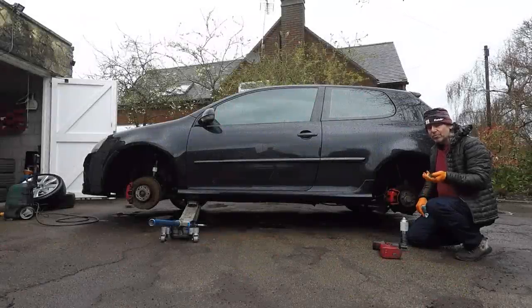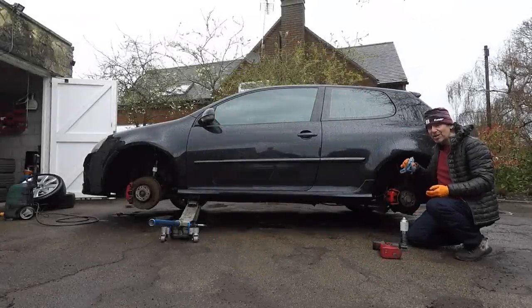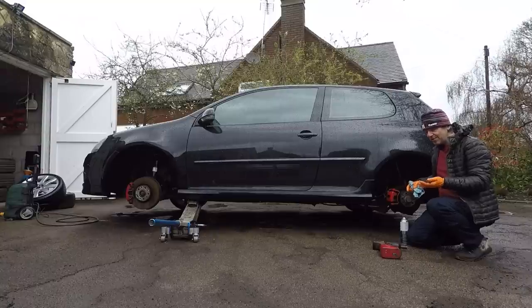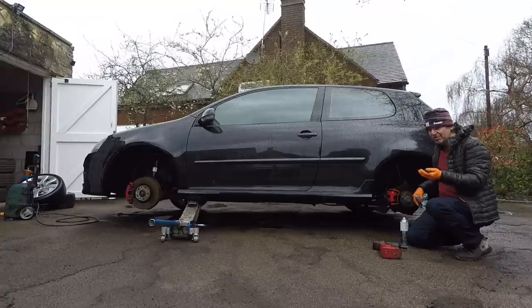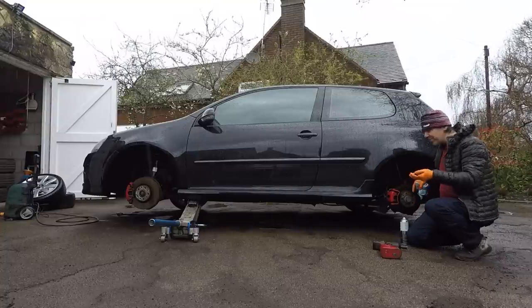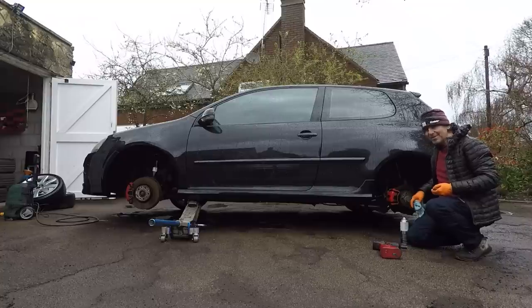Before we refit the wheels, it's really important to dry off your wheel bolts and your hub, because if you don't, you might find corrosion makes it really, really hard to get your wheels off in the future. Also, if your hub is a bit corroded, it's a good time to clean it off and give it a coat of grease. Likewise with the bolts — both of these on this car are already greased up, so that makes life a lot easier. And that means we can get straight on to fitting the wheels.